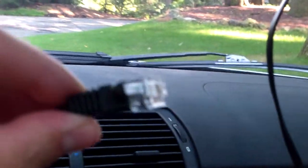That gap will go towards the windshield, and you will have to push at the headliner. As you can see, that light is the windshield, so you want to push at it and sneak this power end out to right around here. Alright, so after some creative pushing and messing up my fingers, there you go. It does pop through. It will be hard, and you might think you're gonna break the headliner, but don't worry. I've done this twice with this car and nothing has happened.